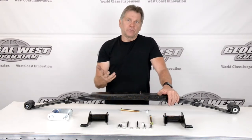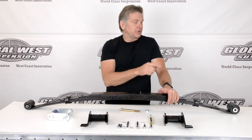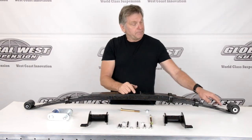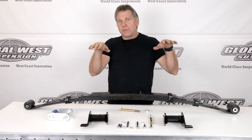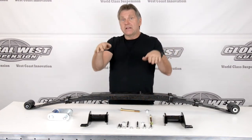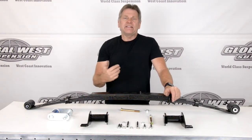What that bind does is create a rising rate rear, which makes the rear end not plant. The inside tire tries to come off the ground. You come around the turn and you can't put power down — it's pretty common with most spring cars. You can get away from that situation by putting a bearing system in like what we do, because that bearing allows the leaf spring to actually tilt. So when you've got it attached and you're going over a bump or around a turn and the differential has to pitch and the body's rolling, that leaf spring allows this action and keeps the tires planted on the ground. It actually softens the rear in that type of environment.